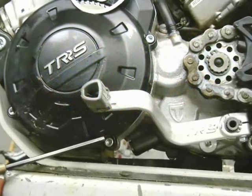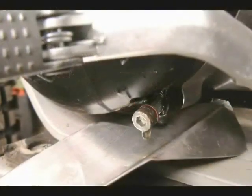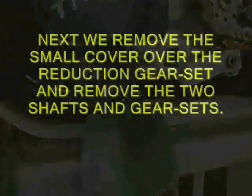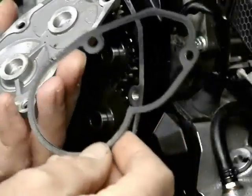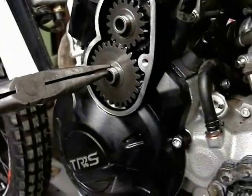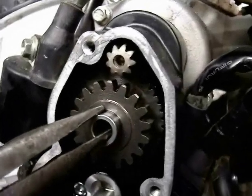There is some oil trapped in the magneto cover. It's an oil bath magneto, which is not uncommon — many motorcycles are like that. There you can see the small sealing washer. It takes a while for the oil to drain out of that small hole. These are very high quality gaskets; you may find you can reuse them.